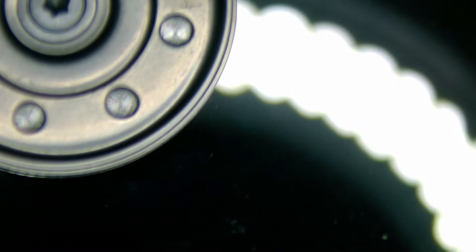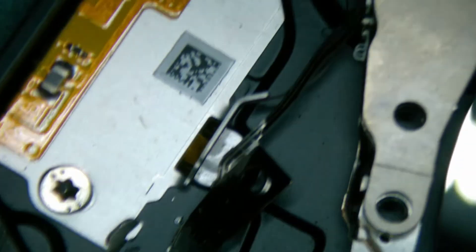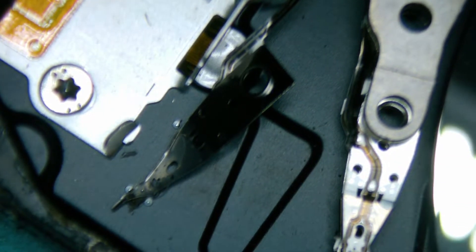There's just too much damage for actual data recovery on this. To see these scratch lines on it — these very, very deep ones — all this surface damage, all this debris, there's hair, there's fingerprints all over it. And it's not even to say that this head is completely snapped off and broken here.